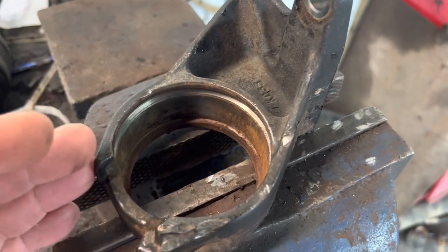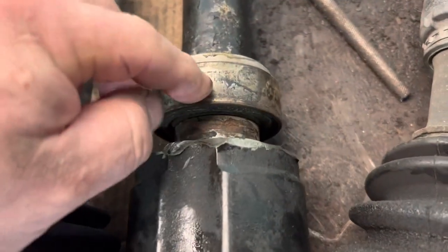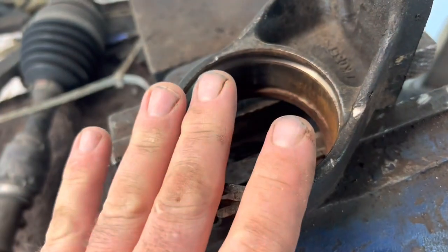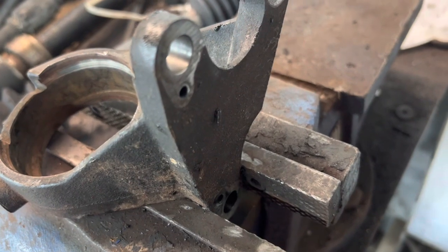I've got the bracket off the side of the motor here. I'm going to take a wire brush and clean this all out inside here. You can see, this is what it is — it wasn't stuck real bad, but bad enough that it just gave me fits. Now we're going to clean this all up so it slides together nice and easy, and I'm going to reinstall everything. You need to put this on first. I've got some alignment dowels on the back side here that make it rather difficult to take off, and the bolts are behind the shaft. Import bolts, most of the time, I think they're zinc coated for resistance to corrosion — they're wicked tight. They kind of snap loose, and then at least when you do get them loose, they're usually not rusted too bad.